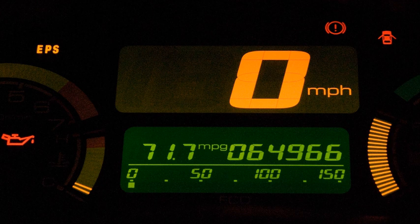Most speedometers have tolerances of some ±10%, mainly due to variations in tire diameter. Sources of error due to tire diameter variations are wear, temperature, pressure, vehicle load, and nominal tire size. Vehicle manufacturers usually calibrate speedometers to read high by an amount equal to the average error, to ensure that their speedometers never indicate a lower speed than the actual speed of the vehicle, to ensure they are not liable for drivers violating speed limits. Excessive speedometer errors after manufacture can come from several causes, but most commonly are due to non-standard tire diameter.